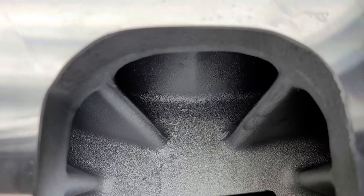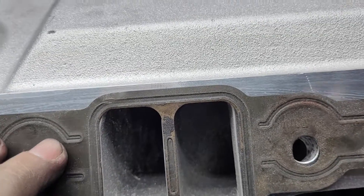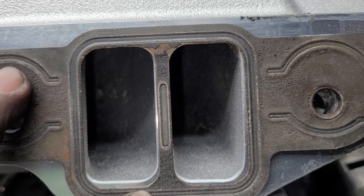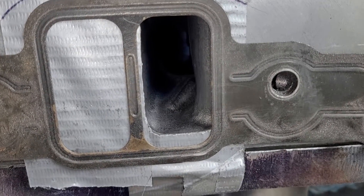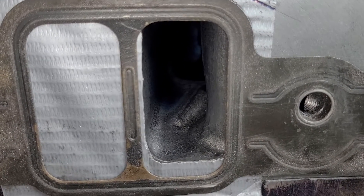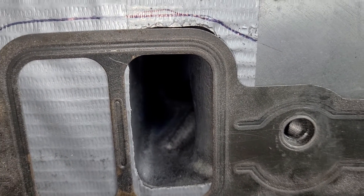Now 220 is good enough to make 400-plus horsepower, but why wouldn't we do a lot better than that if we could? Let's flip this over. An old set of 318 gaskets - they fit pretty good. You remember these 318 gaskets didn't fit anywhere near on the Chinese EQs. It looks like we've got about a quarter of an inch overhang on the bottom, which we really don't want to expand too much, but since we get so much flow through that bottom part of the pinch it may not be that terrible.